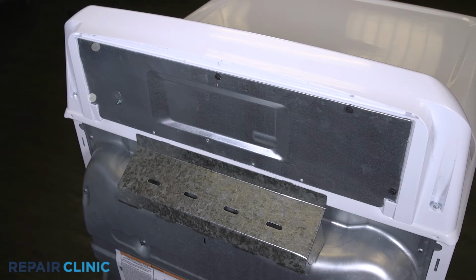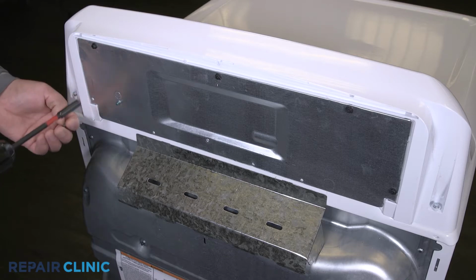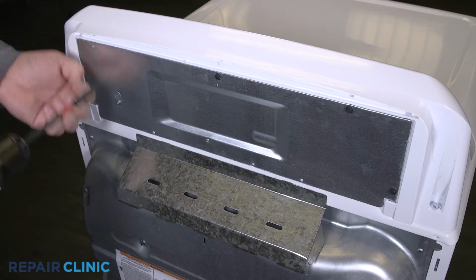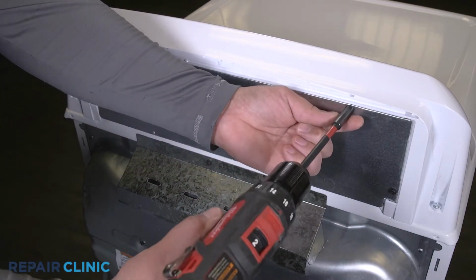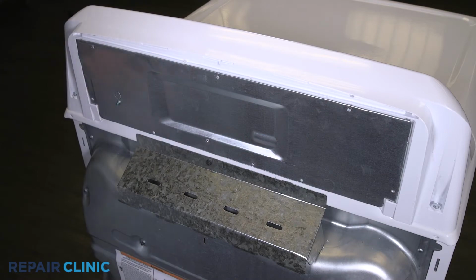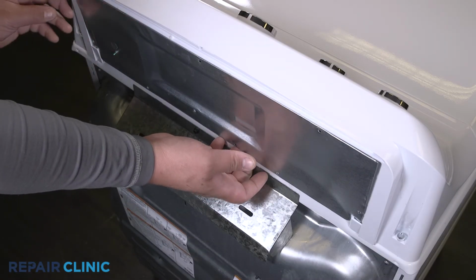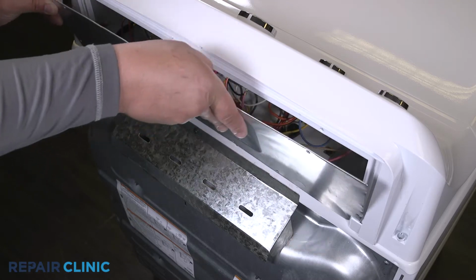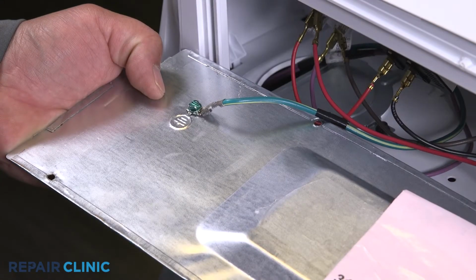Unthread the 5 screws on the panel. Any missing screws can be ordered through the links in the description below. Pull out and lift the panel from the backsplash. Detach the ground wire.